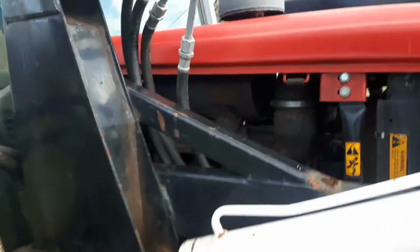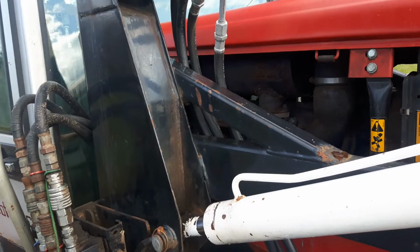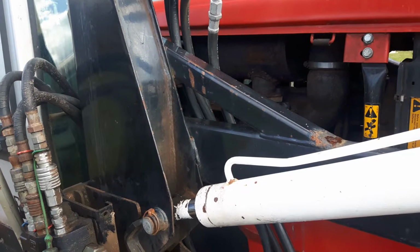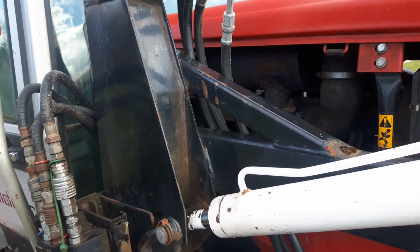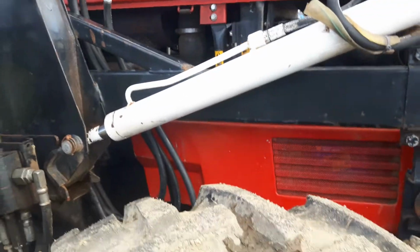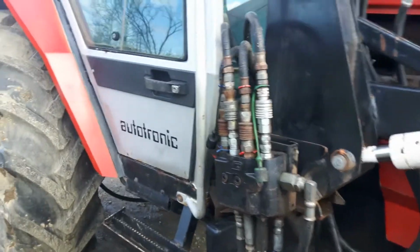So, I'm kind of sorting it out. I started trying to bleed it out. I'm going to put it away for tonight, I guess, but then I'm going to see if, by chance, there might be some air just in the brakes. But if nothing else, I'm going to take the hood off and pull the master cylinders off and put two new ones on. But not a big deal, they're not real expensive. So, yeah, other than that, it's really not too bad a shape.